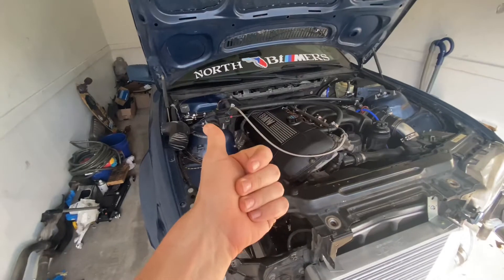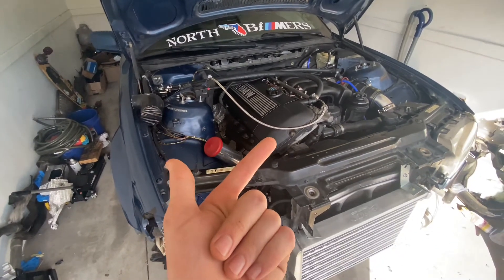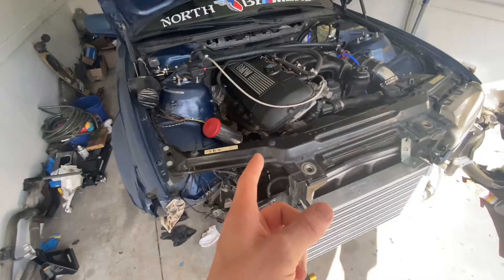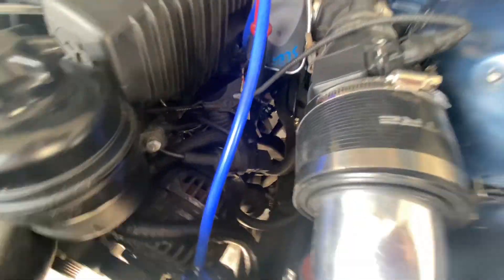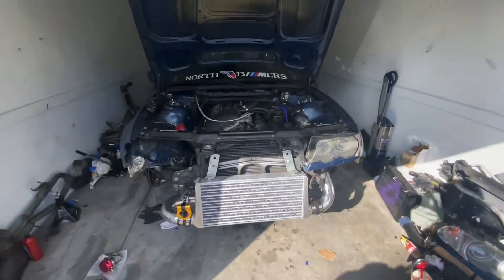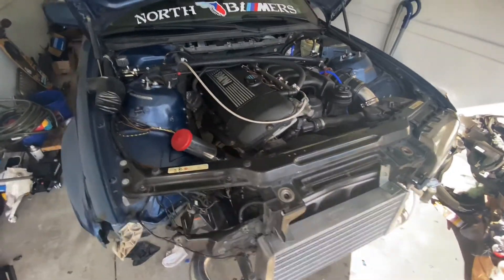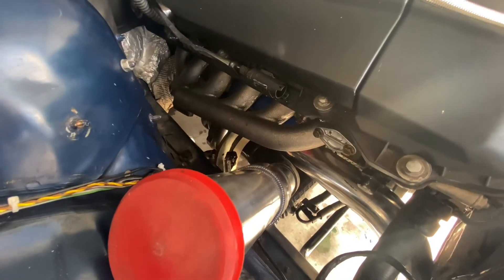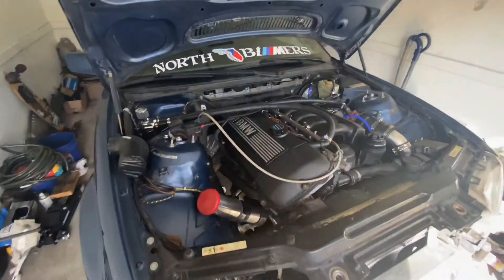Things we've got left: I have to order a set of injectors and return the old set that came in — they weren't the right ones. Got a fuel pump coming in. Besides that, we just have to drop the oil pan and drop the subframe so we can do a new oil pan gasket and get that tapped so we can put a bung on the side. I decided we're actually going to use the oil pan instead of the dipstick tube — I don't like the angle it's at, I feel like it might cause draining issues. Anyway, that's going to do it for this video. Thanks for watching, hit that like and subscribe button, hit the notification bell, and we'll catch you guys next time on Addicted to Cars.